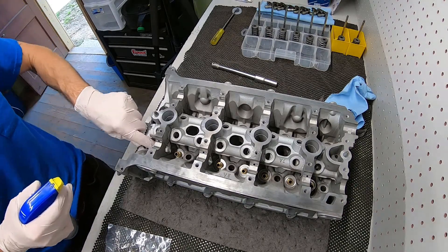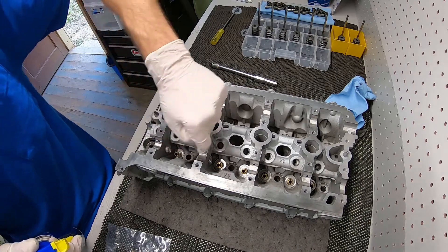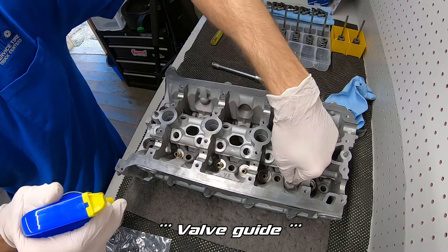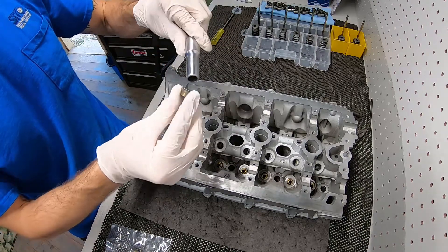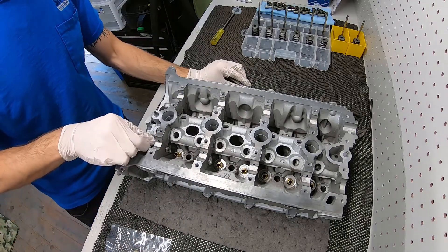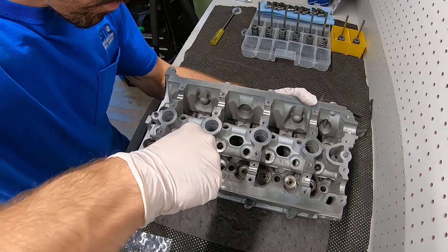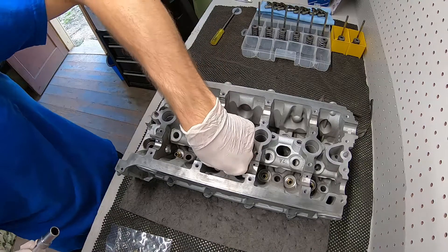I'm going to put the intakes on first. Putting a little bit of WD-40 on the valve stem — tip of the valve stem where the seal rides. You can use a 10 mil. As it kind of pops right on and gets right on the ledge — just press it down if you even need to. I'll put it on this one first. They pop right on, quite effortless, especially when you have just that little bit of lube.